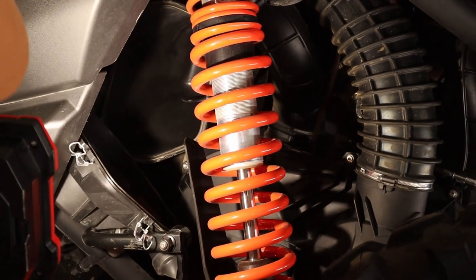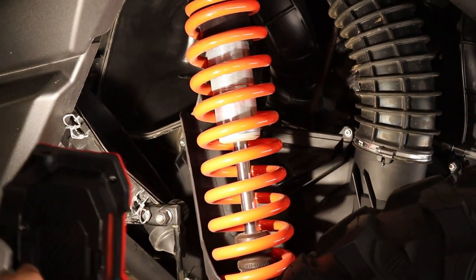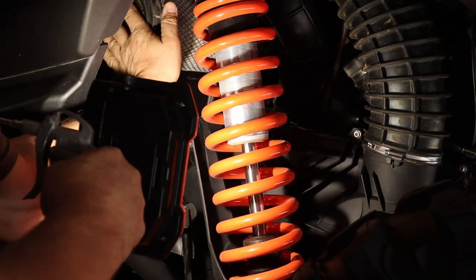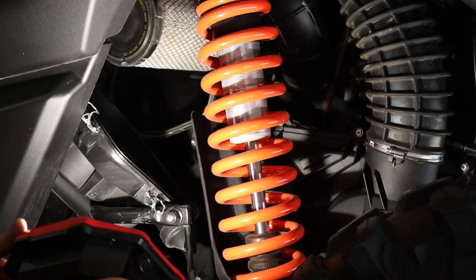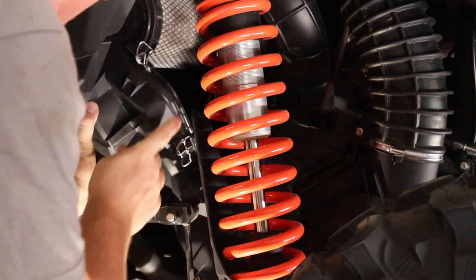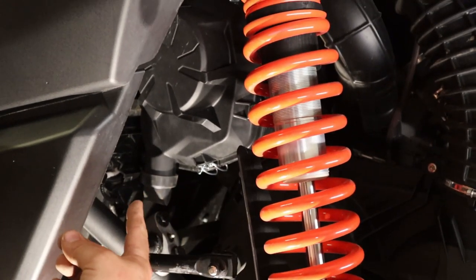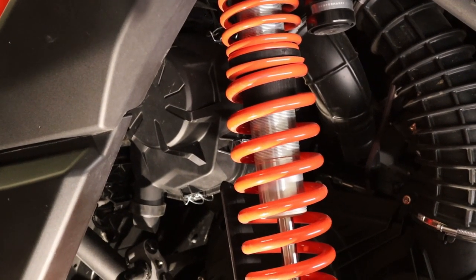The filter is a little dusty but that's natural — you're going to get dust no matter what. It's not to the point of no return. I'll stop by the dealership and pick a new one up this week. The air filter just pops back on — it snugs over the little tube in the housing and just holds in place. So we've done the clutch cleaning, the air filter, checked the antifreeze coolant, and got the screen cleaned up top.